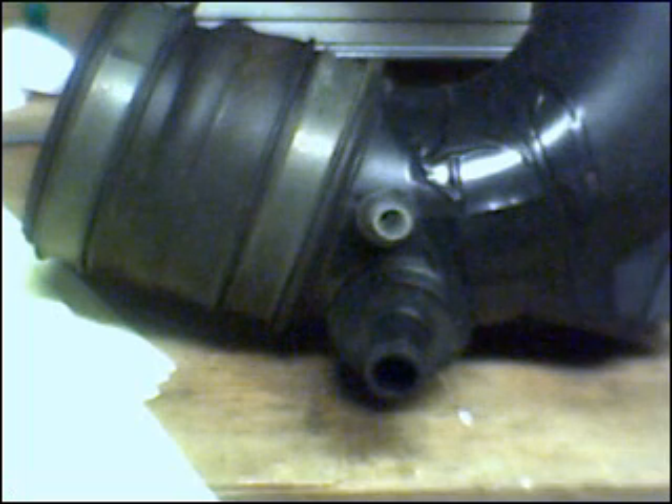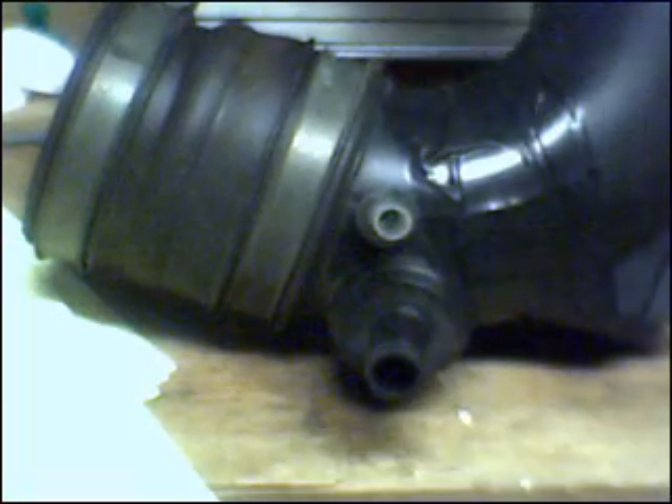This is the ductwork upside down, but I had to mount it this way because of the close camera angle. This is the side of the ductwork on top that feeds the air into the butterfly. This fitting right here is the positive crankcase ventilation fitting, and it is in front of the venturi that I've created. This is the new feed tube that I've added.